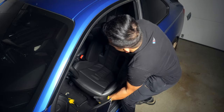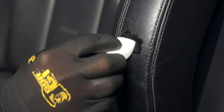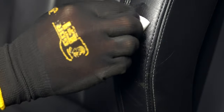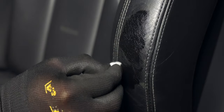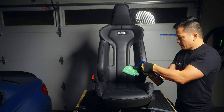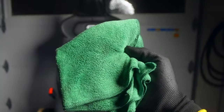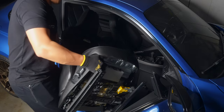For the driver's seat, I did a few things differently. Since there was more damage, I did 4 coats instead of 3 and let it cure for only 24 hours — I really wanted to see what impacted cure time more: the amount of balm applied, or keeping it in a cool dry area like the garage. After the conditioning step, it seemed to have a similar amount of balm on the towel as the passenger side, so if you keep it in a cool dry place like your garage, you should be perfectly fine.